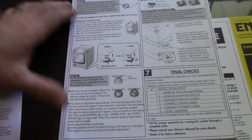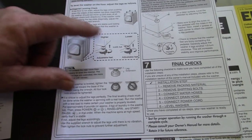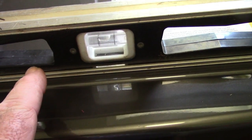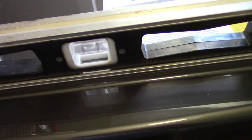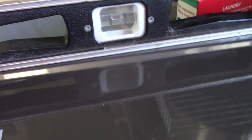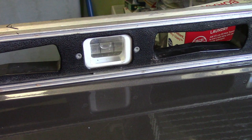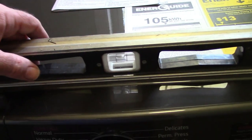Next, connect the power cord and level the washer. Turning the foot counterclockwise makes it taller, clockwise makes it shorter. I have a level on the front — the bubble is on one side, meaning I need the other side to go up slightly. If I tilt the machine one way the bubble moves uphill; tilting it back offsets it. You have to play with the bolts, adjusting until the bubble is centered — do that on both sides, front and rear.